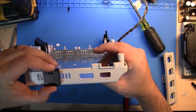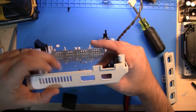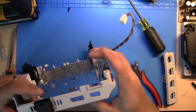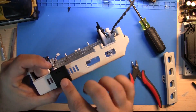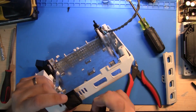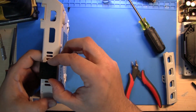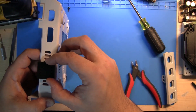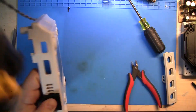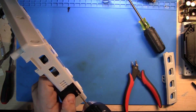You may notice the drill block has a little bit of play. Some cases don't have this play — I've experienced some where this block is extremely tight and doesn't move at all, and sometimes it's a little loose. If it's loose like this one, just push it to the bottom. It has more lateral play — we're talking maybe half a millimeter. Make sure to just push it to the bottom and hold it with your finger. I'm going to put the three on the bottom first and just drill three consecutive holes. Don't drill your finger. Not pushing crazy hard — there's no need to.